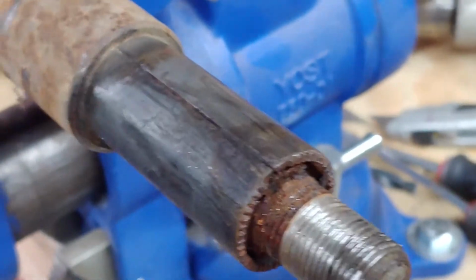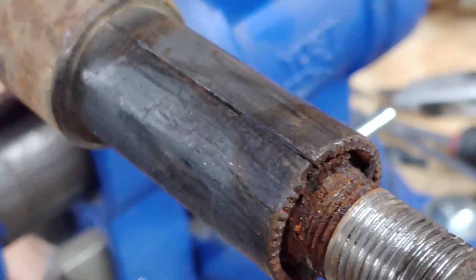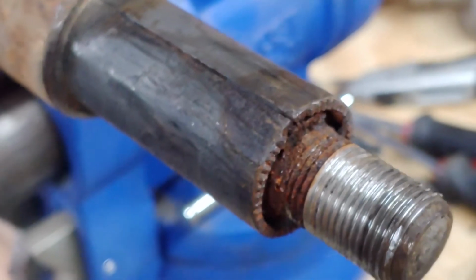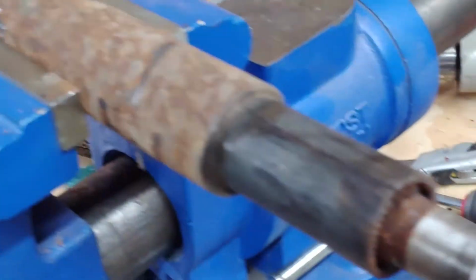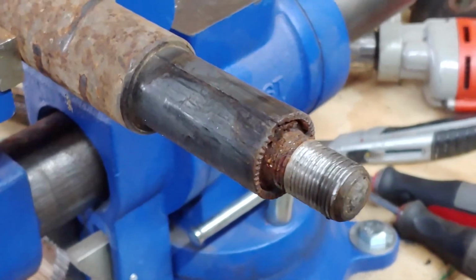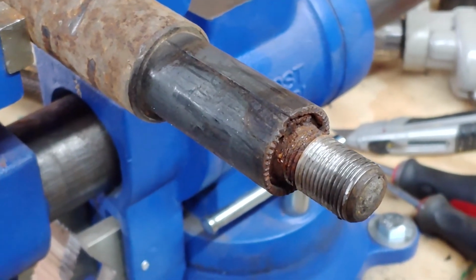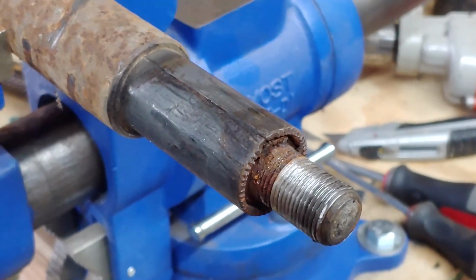Hey, it's very common, and it is indeed what has happened here, the metal sleeve for the rubber bushing is actually rusted onto the shaft. This is the shaft from the control arm. Now in our new poly bushings, that's going to be a point of articulation. It needs to articulate there. We need to lube that, and it needs to be able to move.